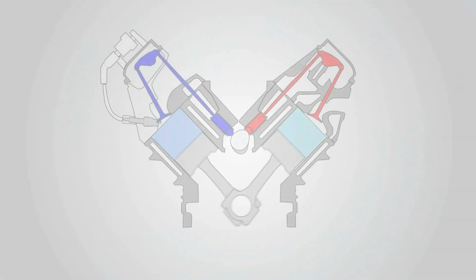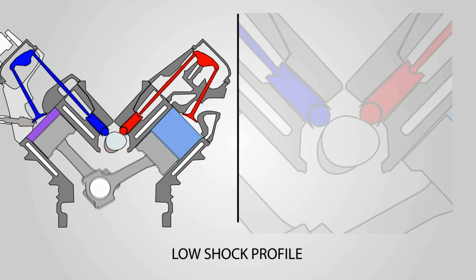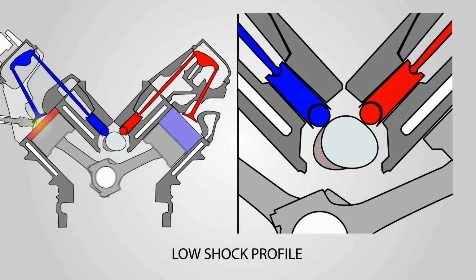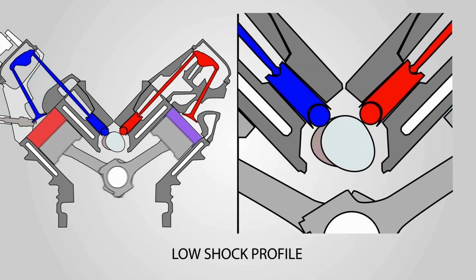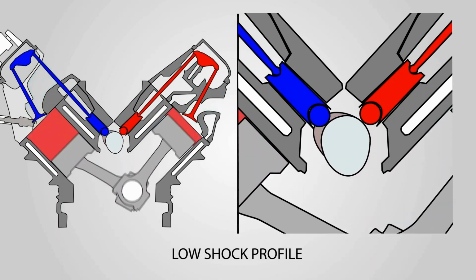By slowly putting in the force on the valvetrain system before we open the valve, we don't shock the valve spring, we get more area on the backside, we better fill the cylinder, all while putting less stress and giving better durability from the entire system.